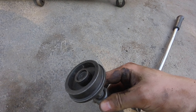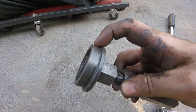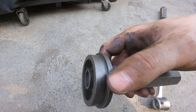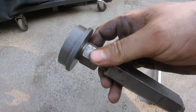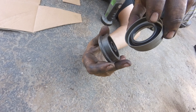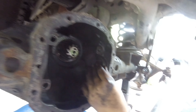To press in the seal, you don't need one of these but it definitely makes it easier — it's an axle seal installer tool. Basically the way this works is it's threaded: you undo one side and tighten the other and it pushes the seals right into place, so you can do one side and then the other. If you want to get one of these, I'll put a link in the description below. This is how you put it onto the tool — it just slides right over. This part goes into your axle and the open part is towards your differential. Just go ahead and place it in the tube.